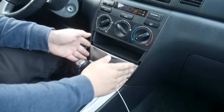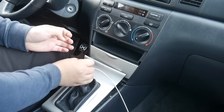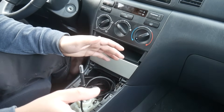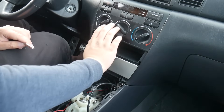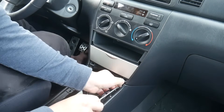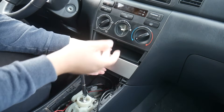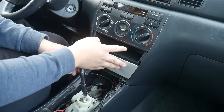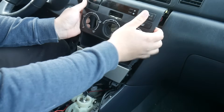We need to take off this entire center console section. First, pull up on the bottom part around the gear selector. Since mine is manual, I'll have to take my shift knob off to pull this out. For those with automatics, don't worry — I'll also be showing how to install the gear selector light for the automatic transmission. First, two screws down here need to come out — that's one and two. Then pop the middle dial off, take out the third screw behind it, and out it comes. Find a good spot to grip and pull it out.